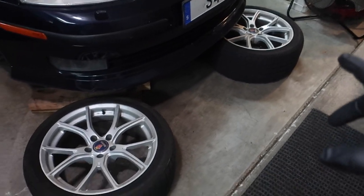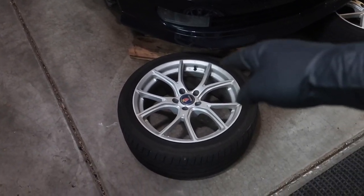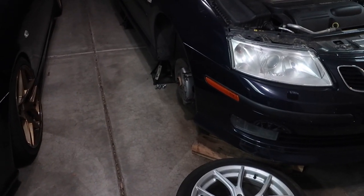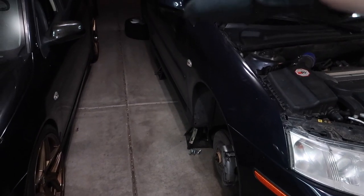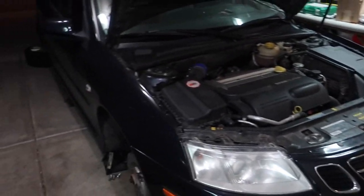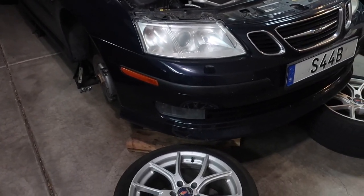With the tire pressure all good, just remember: we're going to be putting the front wheels straight back, so this one's going to go on the back passenger side, this one's going to go on the back driver's side, and then each rear wheel is going to go diagonally to the other side. So I'm going to go ahead and move them around, bolt it back up, and we'll be good.